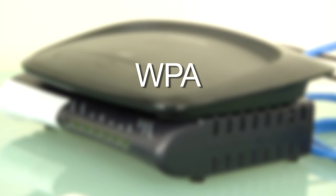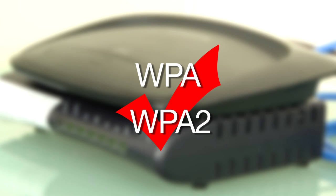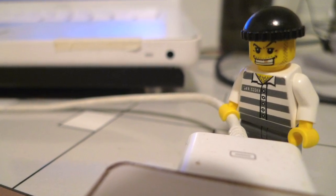After that, you'll certainly want to make sure to secure the network, which usually involves logging into the router either via wireless or through a hard connection. I suggest using WPA or WPA2 encryption, because it's the strongest compared to WEP protection. Make sure to choose a secure password, because it's pretty easy to have your wireless network broken into, which could expose your personal information.